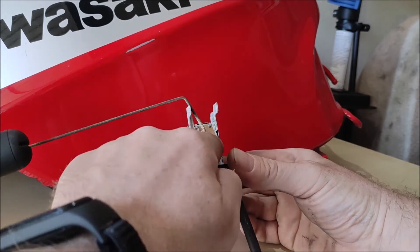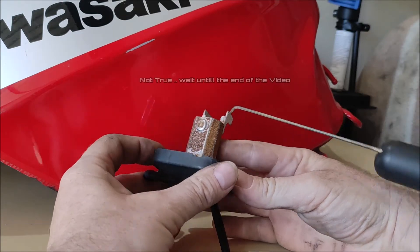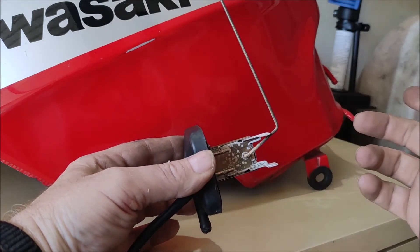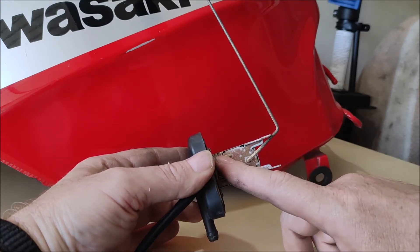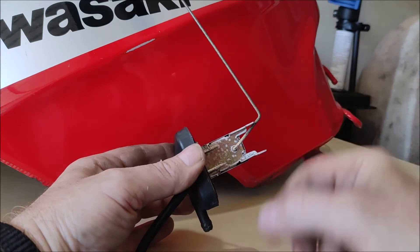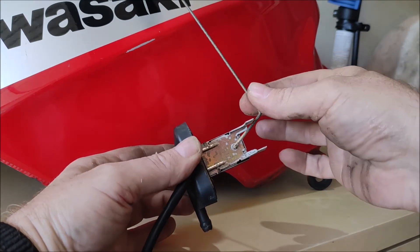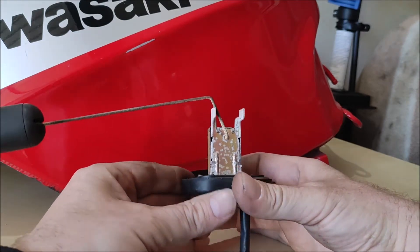This is a potentiometer. Depending on the position of this arm, inside here there's a metal scale and this arm has a pointer on the inside moving up and down that scale. It's a resistor — when the arm is in one position there is more resistance than in another position. Due to this change of resistance, via the connector to the fuel gauge, it moves the gauge. It's obviously matched so that when it's empty it shows empty, and when it's full it shows full.